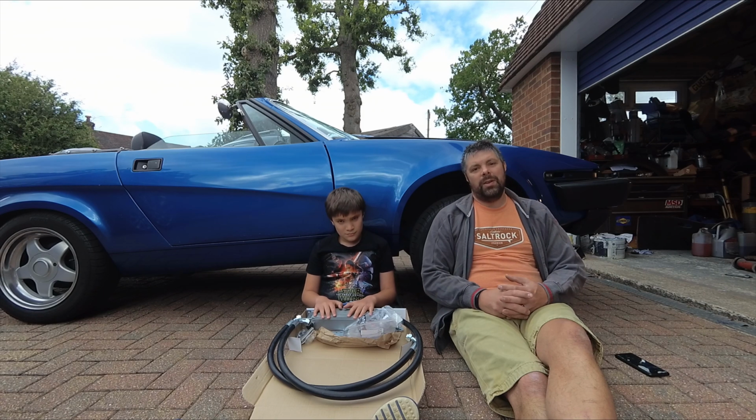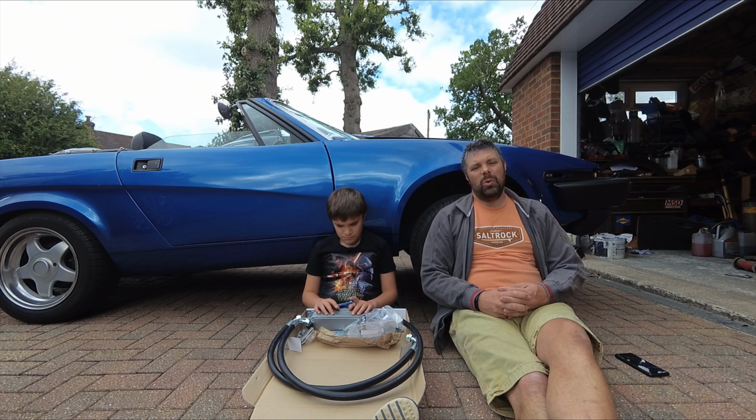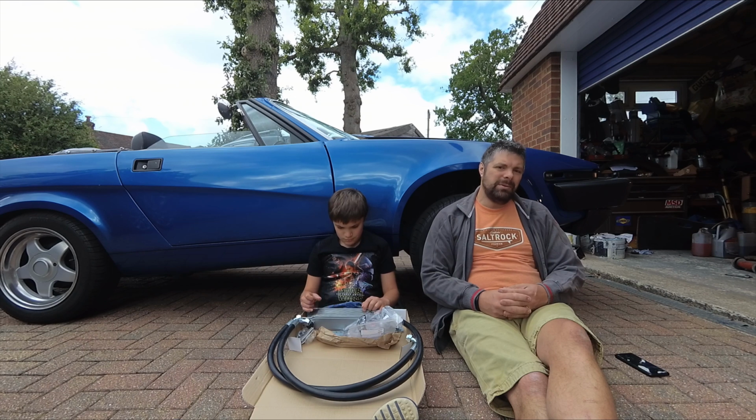After a spirited drive the other week, I noticed that it was getting a bit warm under the bonnet. Oil pressure was a touch low, and the air-fuel mixture wasn't quite right anymore. But the radiator temperature was fine, the fan was cutting in. So I decided to invest in an oil cooler. Hopefully this will also future-proof the engine for some upcoming mods.